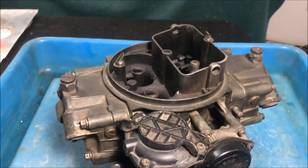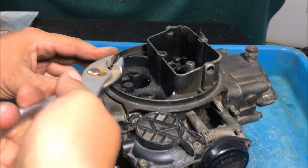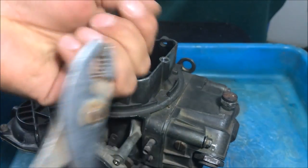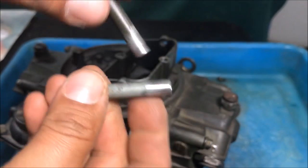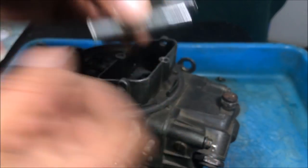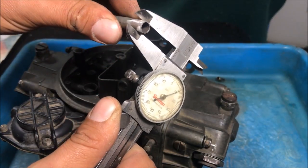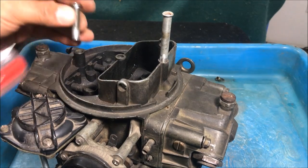Let's do the vent tubes because they're super easy. These are too short, and especially the way they cut them, fuel can possibly splash out. These are five-sixteenths brass tubes — they come out pretty easy. I didn't buy any brass tubes; I just got some five-sixteenths steel brake lines. The steel is a little bit bigger on the outside, so I had to grind them down. The original ones are 0.308 or 0.309 of an inch in case you're trying to find some.